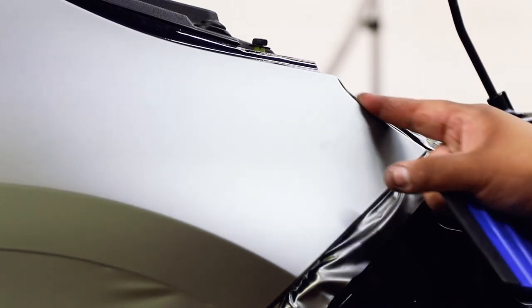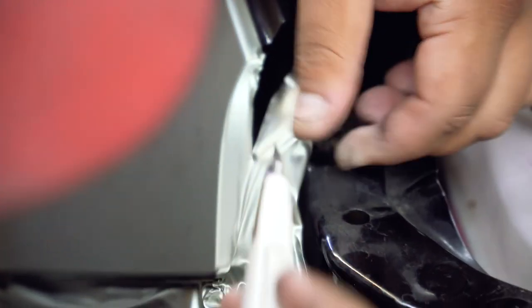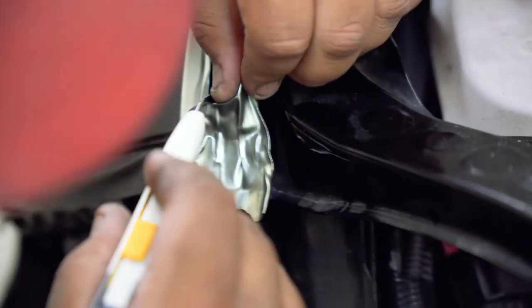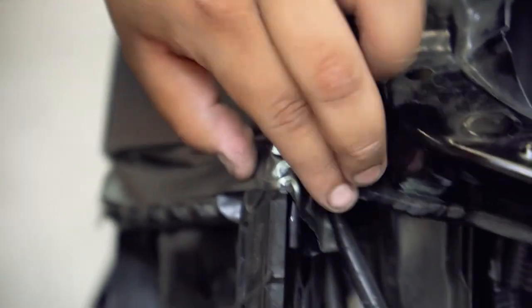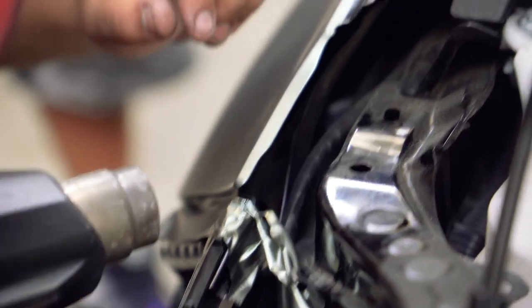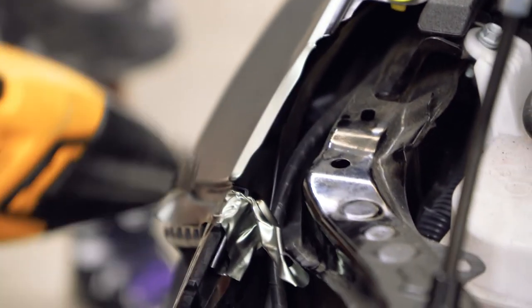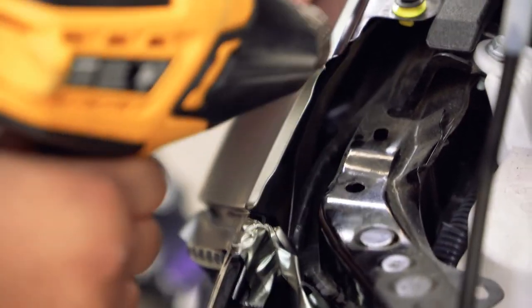Now this is the corner. I'm not going to cut this film on the edge — I'm actually going to give it about an eighth of an inch and cut up, an eighth of an inch, just because this film will shrink a little bit. So then again we'll go back to the heat gun. I'm going to heat it and just push it to the back. Keep the heat gun moving when you're post heating — you're not really post heating this film because it's going to turn gloss. So you're going to want to keep it moving around, back and forth.